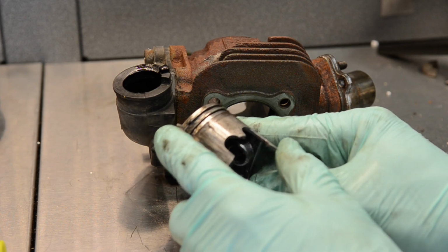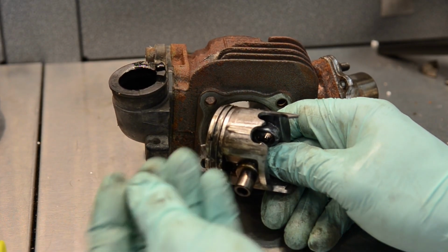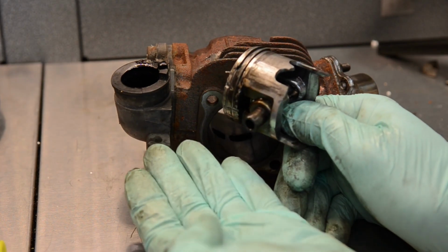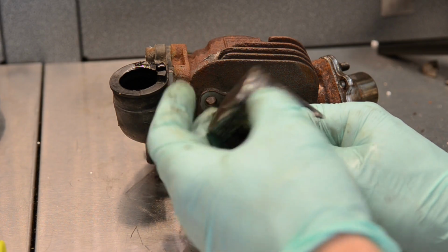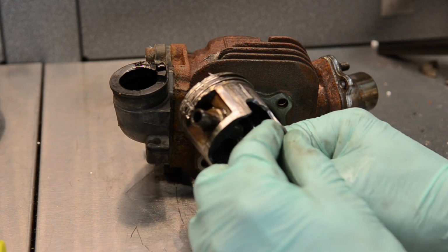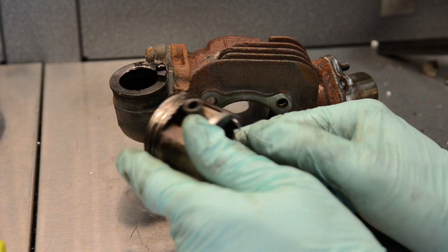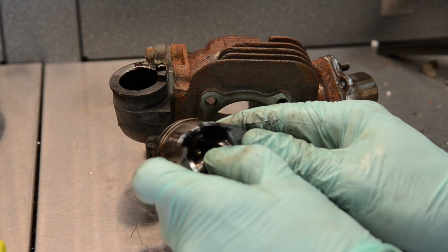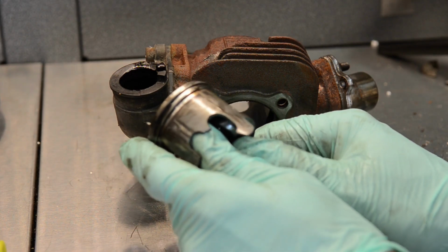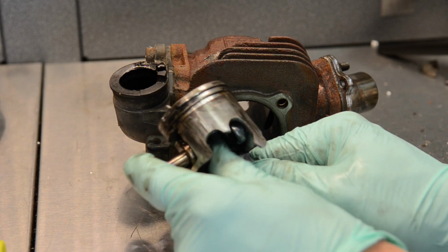Because now I'm left in the situation where I have to clean out that engine. That could mean splitting the engine in half. The only two big pieces that I could find are these two, and everything else is mashed into smaller pieces, which means maybe my crank is even damaged. Usually when the ring goes, it just goes, and the ring's so soft that it doesn't really destroy the engine. This potentially could, because these are big pieces. Now they were on top, so maybe it didn't do any damage. Maybe it did. I won't know. So I have to do a little investigation and decide whether to split it or just chance it with the new kit. If I chance it and there's a bit floating around, it'll break it again, and I'll be in this situation again. Splitting it is a couple of hours work, but it might be worth it.